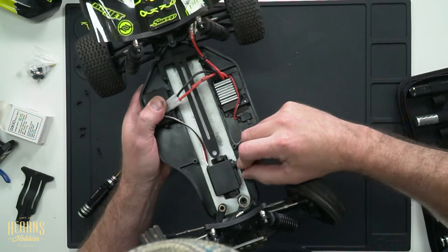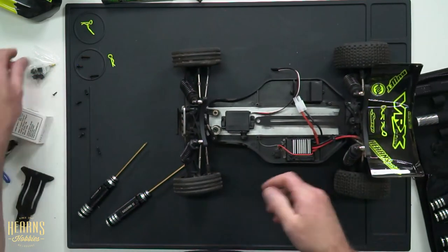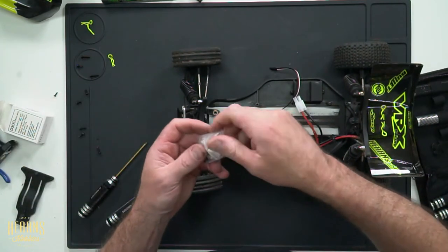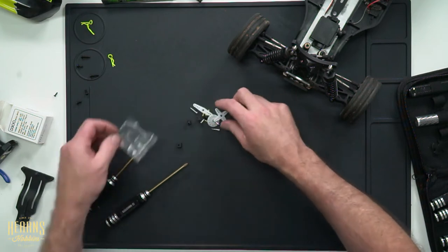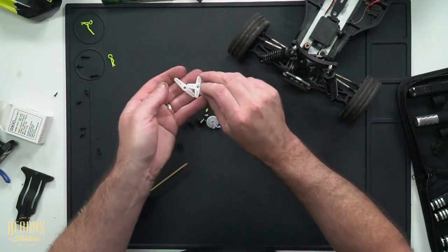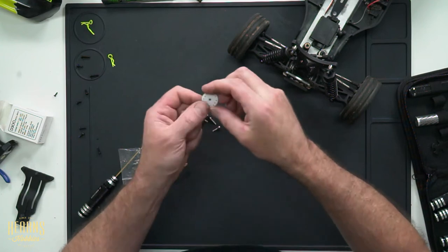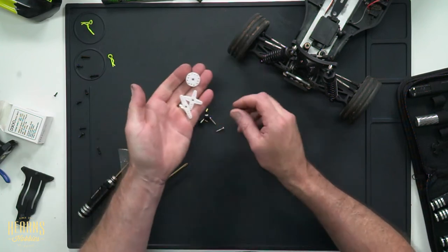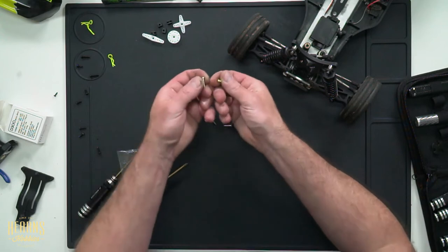The horn slips straight on, pressed onto the spline, and it feels really nice and smooth. Now, if the servo horn from the kit didn't fit — in the D300 kit there is in fact a range of three servo horns, and you can cut off the ears you're not needing. You can even shape the circular one into a long point for various applications. The kit also includes mounting grommets and mounting hardware in case your car doesn't have any, but luckily we can repurpose all the bullet's existing hardware and keep moving forward.